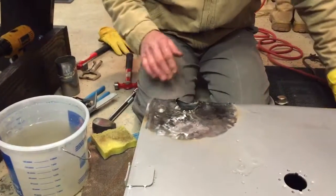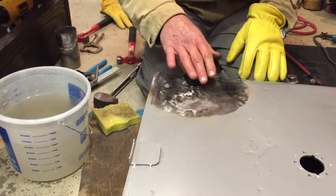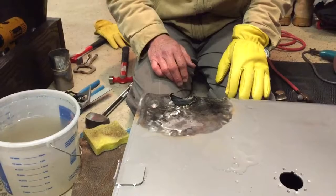It's going to be a lot of work, but basically continue that, continue dollying, and I'm using my sander to kind of sand and see the high spots and the low spots as I go at it. And that's where we're at tonight.